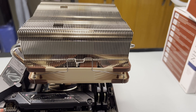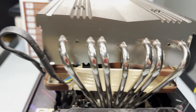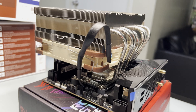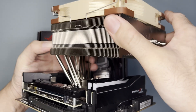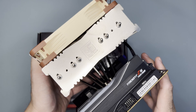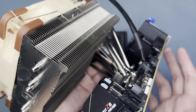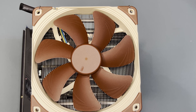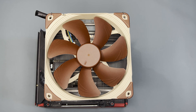Overall, the NH-C14S offers capable cooling performance in a compact 115mm tall design that will fit well in some smaller cases. However, its 115mm height may still be too tall for many SFF cases, and for maximum cooling performance, larger coolers or AIOs might be better. It can also cause some clearance issues and may be tricky to install in certain setups. Additionally, my benchmarks are based on the 7800X3D, a relatively easy-to-cool CPU, so the cooler may perform differently with hotter CPUs. Anyway, that's it for this video — do let me know in the comments what you think of this cooler. Thanks for watching, and do like or dislike and subscribe for more unboxing, SFF builds, and benchmarks.